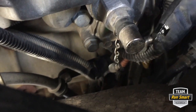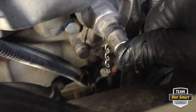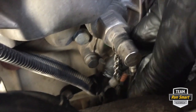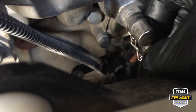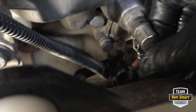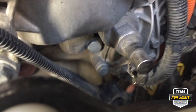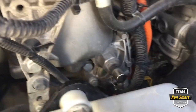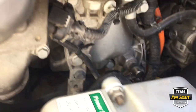Right here is where the oil is going to come out of. This thing will turn in about any direction. Get the bottle underneath it and then just push the valve in. It doesn't move very much, and the oil pressure from the engine will fill the bottle. You don't have to be all the way full, but you do need enough for them to do their work. Put the cap back on the sample port. The sample port is in the same place on the DD15 and DD16 — it's just a little easier to get to because the longer hoods allow the engine to be forward a little farther.